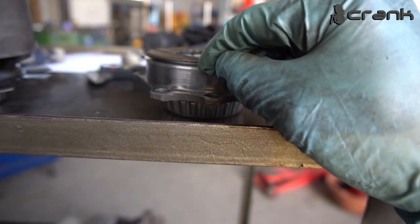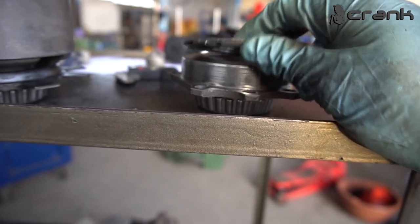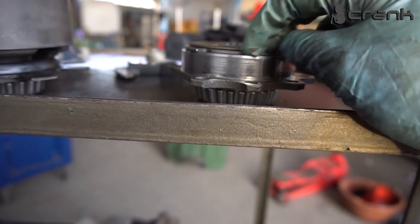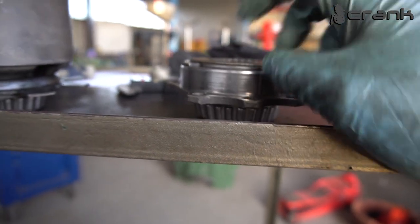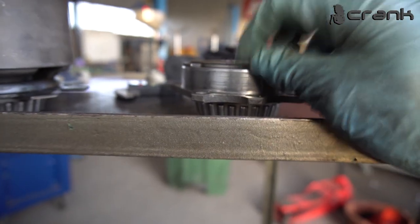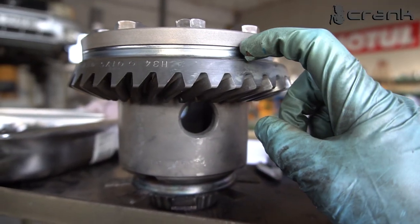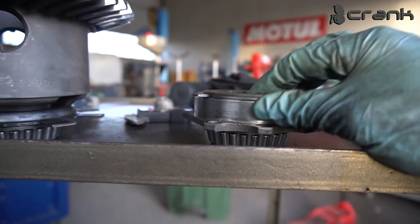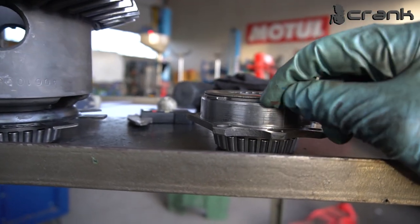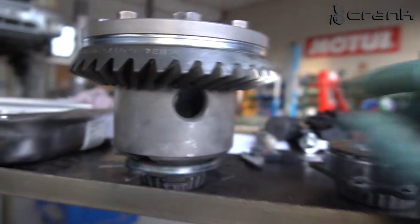So originally this cup was 4 millimeters higher, and because the previous differential builder wanted to make room for this 4th pair of clutch packs, he removed 4 millimeters of the height of this cup. So originally this cup was 21 millimeters, and on the petrol cases, once again the higher ratio differential cases, this cup is 14 millimeters. Once again, 21 minus 7 millimeters, you're going to get 14 millimeters of height. And if you want to put a 4th clutch pack, you're going to remove 4 millimeters from 14, and you're going to end up with a 10 millimeter cup for a petrol case, LSD case. Hopefully this makes some sense to you guys. Hopefully.